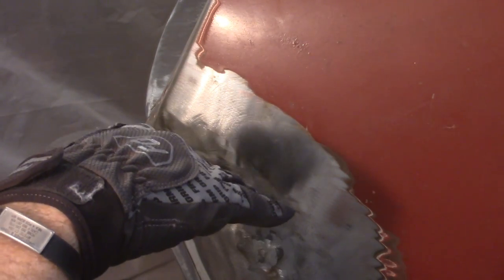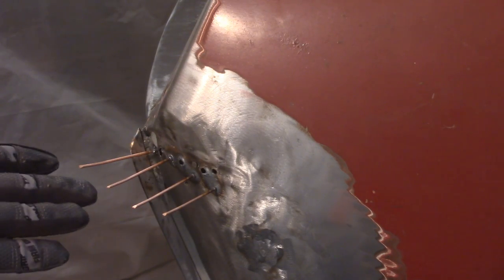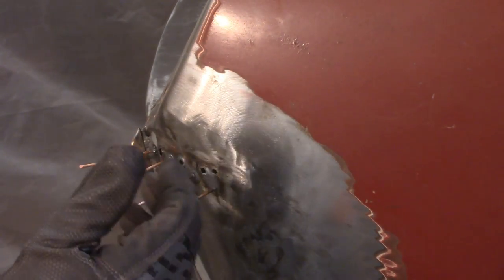So now I'm working on this crease. Figured I'll try to bring the bottom out first this way and then try to bring that top down, because it snakes in kind of, so I've got to bring it down and out. I know I'm kind of zoomed in, you didn't see my hand. Also, as with anything, as you get more experience, your technique develops a little bit. I probably should have known this and thought about this, but it's relatively thin metal on Dorothy here. It's only 20 gauge metal, so it's not too bad.